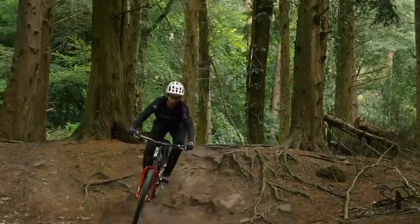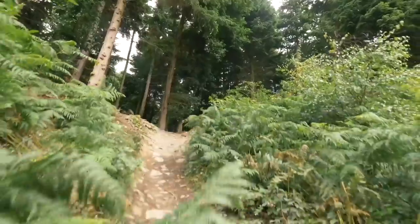What can happen is when you want flatter trails and you haven't got that force driving behind the front axle, the stability goes. It can't be viewed in isolation because things like chainstay length and your front center also massively affect this. People find when they ride bikes that are quite slack on trails that aren't as steep, the bike feels a bit less stable — it feels like it wants to flop and fall over. But that's largely the gist of it; it's a way to affect where the weight sits on the bike, more rearward or more forward.